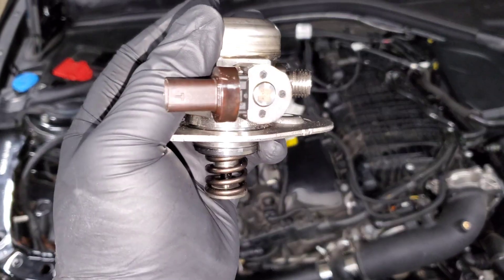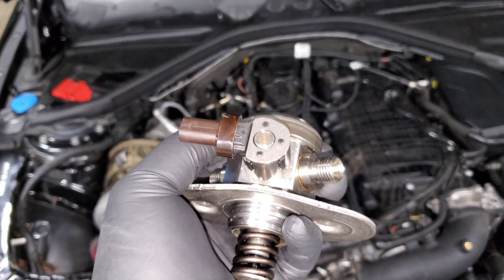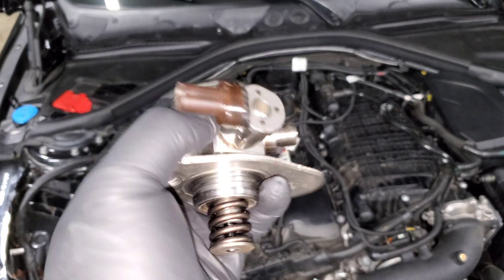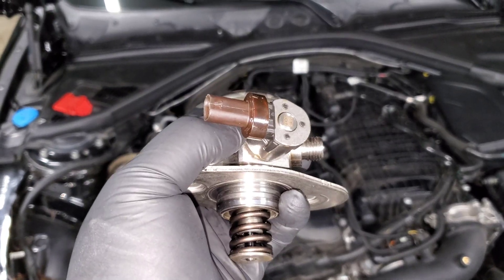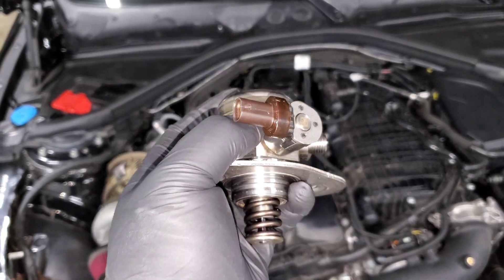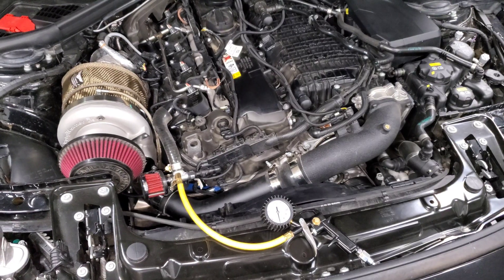So it works in conjunction with the pressure sensor. What I was trying to address was that a lot of people thought this was the pressure sensor itself, so if they were seeing rail pressure drop they assumed something was wrong with the fuel pump and that it had failed. In a way that can be part of the problem, but it's not typically true — I was just trying to redirect you guys from focusing on this sensor itself.